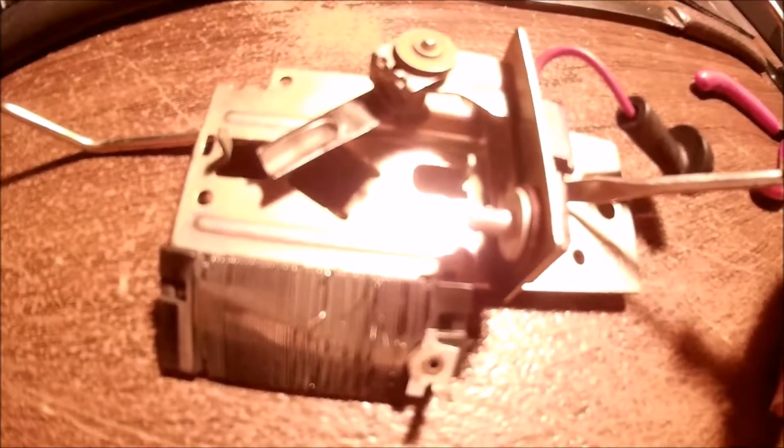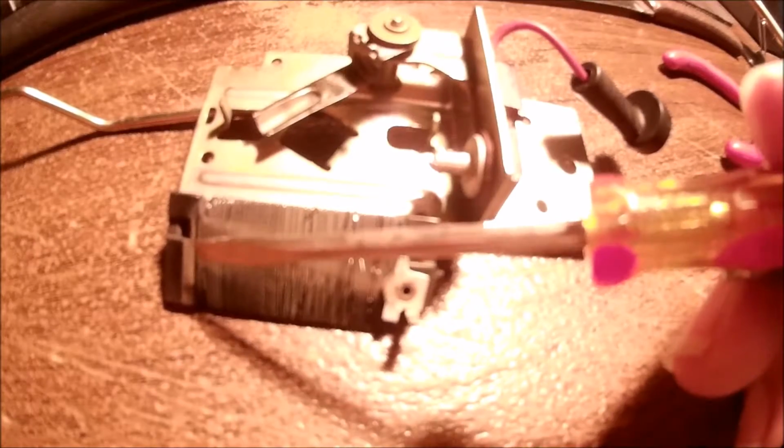Just a little duh on me. This little tab here that those wires are on, go to this, which go to this side, which go to this wire. And this feeds your gas gauge circuit. The wiper arm is part of the body. The body is attached to the stem that holds the fuel pump, which is part of the flange, which is connected to the gas tank, which is connected to the frame. So that's ground. So there is no other end down here that needs to connect to anything. It connects through this arm. Next up.